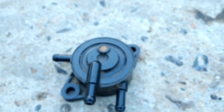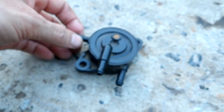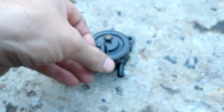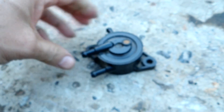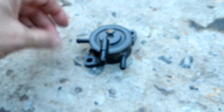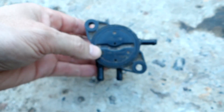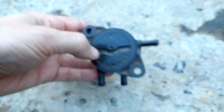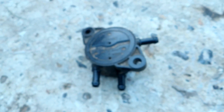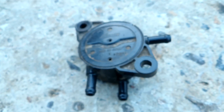I've got a vacuum-powered fuel pump here — this one happens to be off a John Deere riding mower, but it could be off Briggs or Kawasaki motors or what-have-you. This one attaches to the crankcase, one port goes to the gas tank, and the other goes to the carburetor. So it's just a vacuum-powered diaphragm-type fuel pump. I'm going to dissect it and see what was going on with this one because it wasn't putting much fuel out — as soon as I put a new one on, the motor ran normal. Anyway, I'll proceed to cut this thing apart and see what's inside.